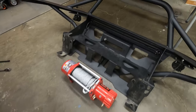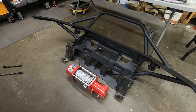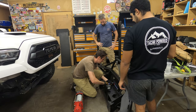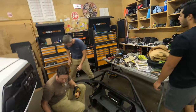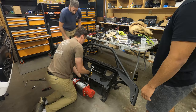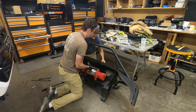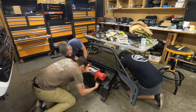Now that we have the bumper off, we're going to put the winch into place and see if we can put the module on top, if there's going to be enough room underneath the grill. One of the first steps when setting up your winch is to correctly route the line underneath the drum of the winch and out the front of the bumper. Set this up first so that you don't have to fiddle and push that line around after you've mounted it and cranked it tight down to the bumper.